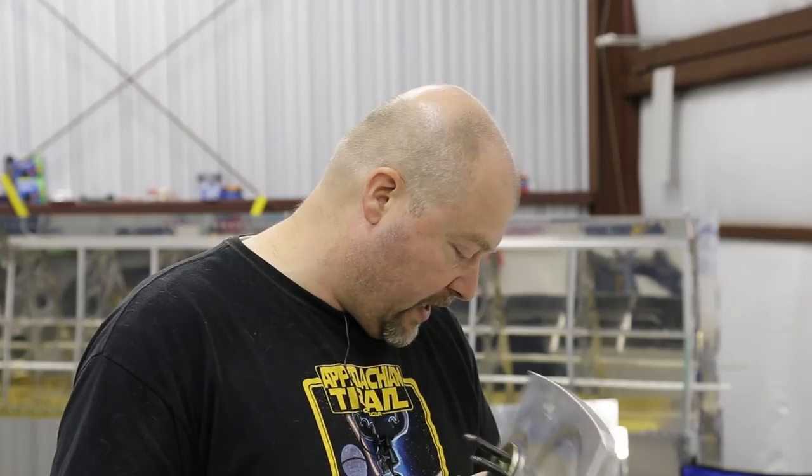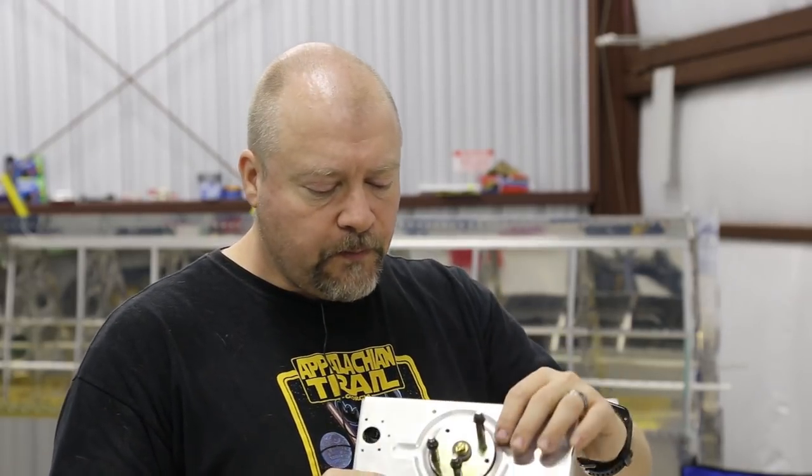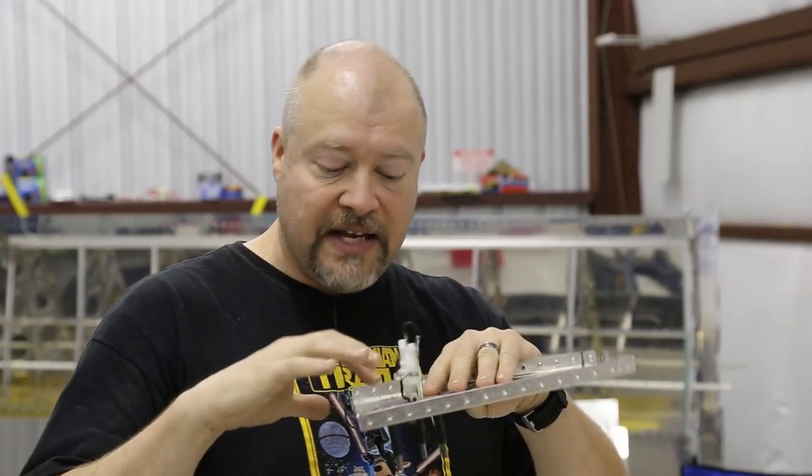I want to talk about this particular tank sub-assembly — the inboard part, which is where your fuel sender is. On the end is where the fuel sender actually attaches: there are five holes supported by nut plates underneath. This particular fuel sender can only go on here one way, which is great. I have the float fuel sender, and I've got pictures of how I made and got that working — very clever, very simple. Because of the nature of this piece, these nut plates have to either be countersunk or dimpled, and the plans don't really discuss that real well. This goes back to the whole 'we're not going to hold your hand' thing with Van's.